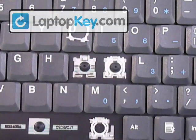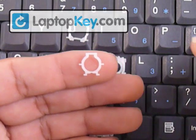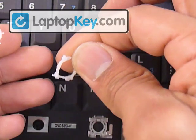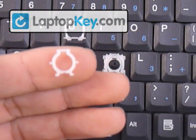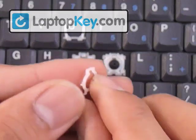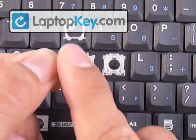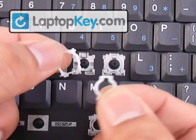Put the large hinge down in the right position and get the small piece. This has a bar at the top that's going to go underneath the large hook — that's how you know its correct position. The middle pins will click onto the holes in the middle of the large piece, and the bottom pin clicks onto the keycap. Make sure not to put this piece upside down either: feel underneath the sidebar or middle pin — if you feel an extra bump, that faces the keyboard, and on top it should be smooth. Now you know the correct position for both pieces.